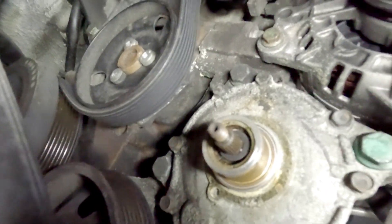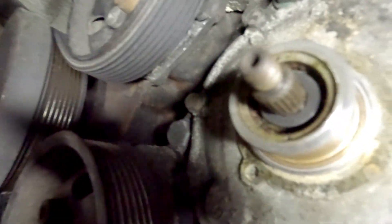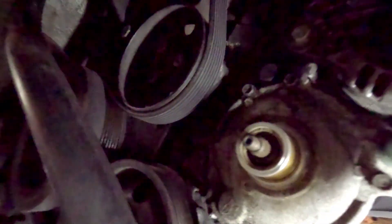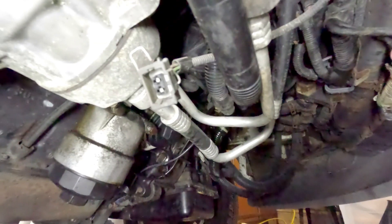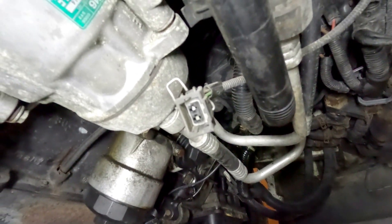There's another big snap ring that we have to take off to get this other piece out. The wire runs up above and connects over here — that's the actual connector. So I took the snap ring out, slid that out, took the wires out. Now I'm going to take the new one, slide the wire back in there, slide this back on, put the snap ring back in, reconnect it on that end, and put it back together like we did before.